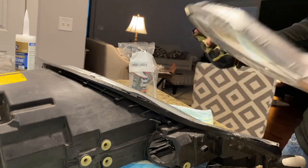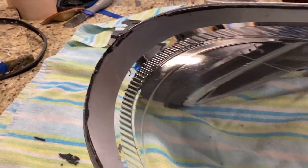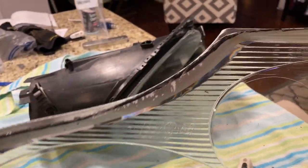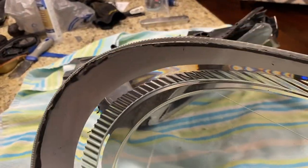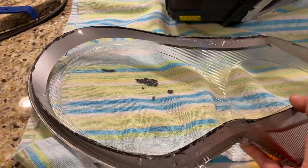All right, two done. Once it's all separated and cleaned up, you'll probably have some gunk in the lens on the inside, and you want to use compressed air to get that out — don't put any water or anything in there or touch it. To seal it up, I'm going to use clear silicone when I reassemble it. There's also automotive butyl bead you can buy to put on there, but I've heard that's harder to work with, so I'm just going to use silicone. If you want to see it being put back together, check out my video on upgrading to the Retrofit Lab lights.